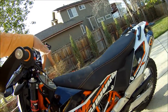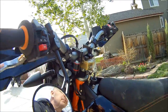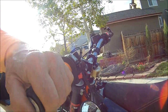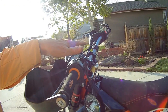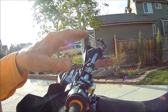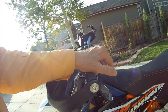On this bike, it was about $600 because you have to get this bracket that has this pin sticking up. It's like a shock absorber if you hit it really hard, and you can adjust the tightness of that to make sure it always keeps going straight. The road racers have to have stuff like this, otherwise they'll get speed wobbles. You're going 150 miles an hour and you get a thing going on, so you have to have steering stabilizers. So I just decided to do it. I haven't fallen down with this yet.